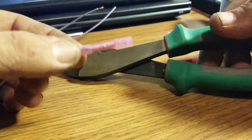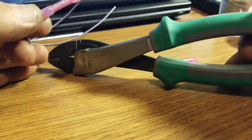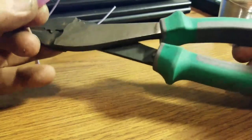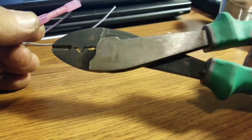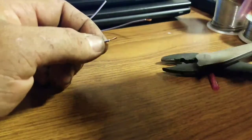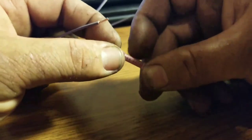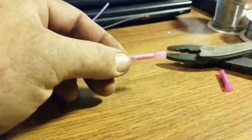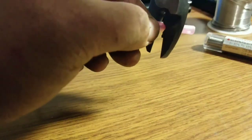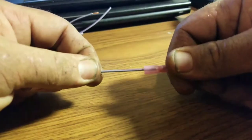The main thing is to have a good pair of crimpers — I think they call them stake-ons. These ones I got at Home Depot for 20 bucks and they're my favorite. I have some name-brand tool truck ones, but I use these before anything else — they hardly take any force to crimp, they have really nice rubber handles, and they're heavy. Some of these connectors have an actual cut in them, not a solid tube — if you see it's cut, you want to crimp the opposite side of that cut, because it'll keep it from coming apart and it'll crimp correctly. When you crimp these correctly it's almost impossible to pull them apart; you'll more than likely rip the wire before pulling it out of the connector.